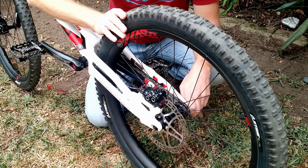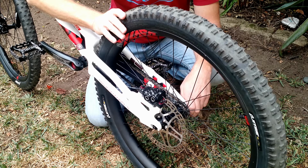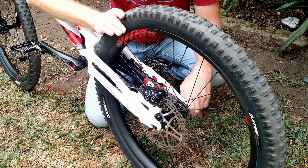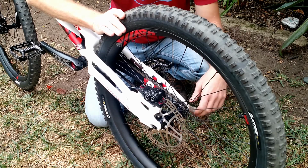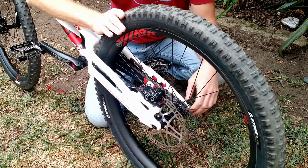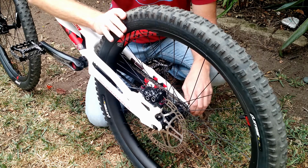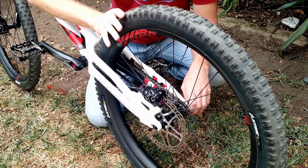And the brakes are not as strong as a rim brake in the rear. You notice that when you're doing the extremes, when you're doing drop gaps, really forcing it, or actually it's mostly when you make mistakes, when you're not quite dead center when you land on something. That's when you notice that you don't have the amazing power of an HS33 rim brake. But for everything else, it's pretty great.